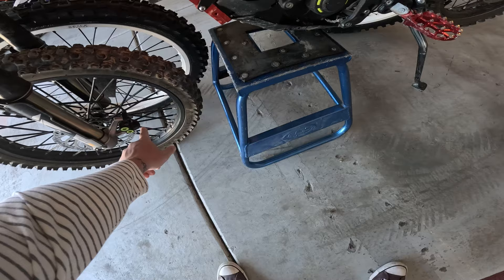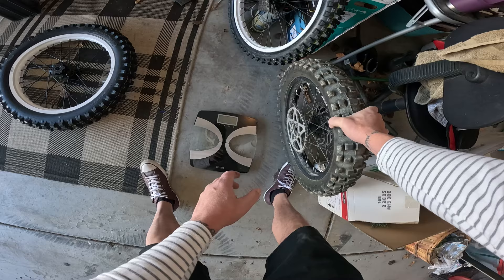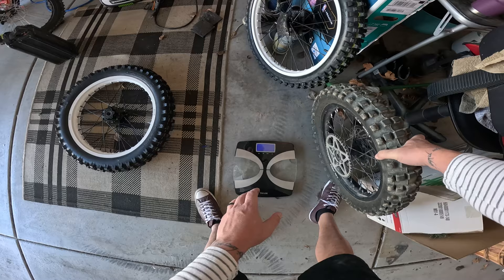When you're taking off these tires, it's always a better idea to take off the calipers — just undo these screws, take the whole caliper off and let it hang. It's a much easier way to get on and off the forks and the swing arm. I'm going to weigh this 16-inch rear wheel on this scale to see what the difference is with the 18-inch rear.